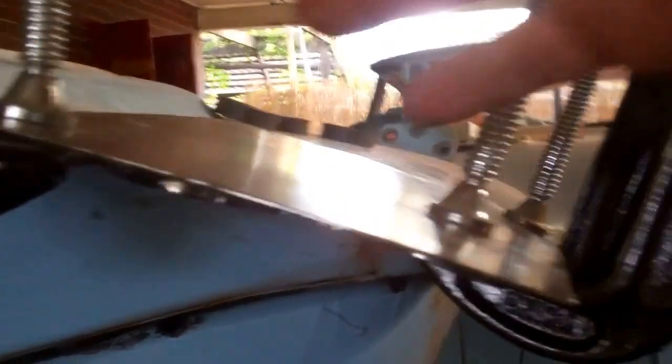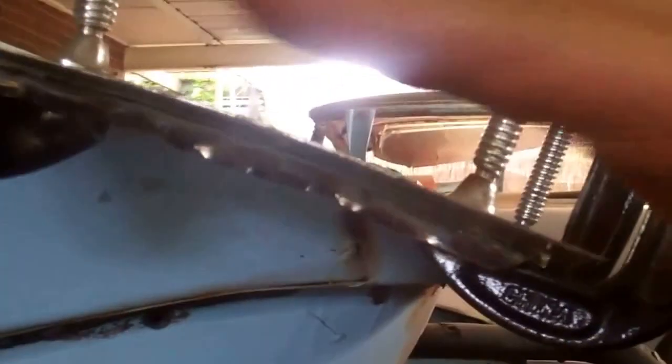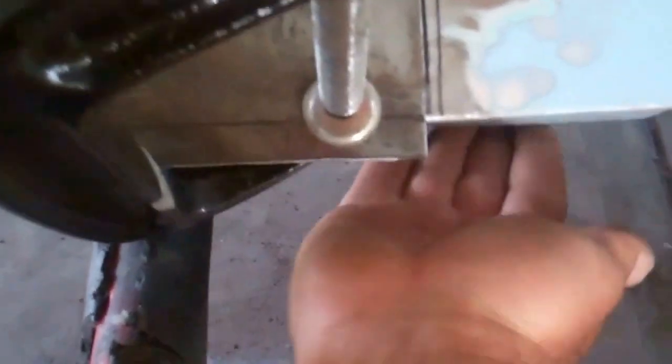This is basically what I'm doing to put the patch on. I've cut the basic shape out that I need and I've just got some clamps on there before I do any cutting on the door itself. I'm using the existing panel as a mould so I can press my new patch panel against it and get the basic curvature I need. I'll let that sit for a while and work that in. What I've also got to allow for on this patch is the fold-over sections from under the door. When you replace a patch on the bottom corner of a door, it's always a good idea to leave some excess so you can turn that over back under the door later on.